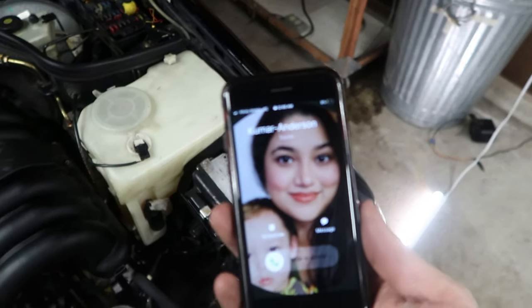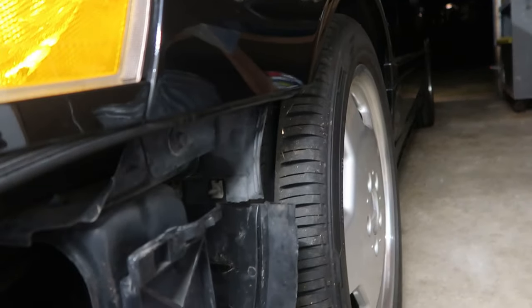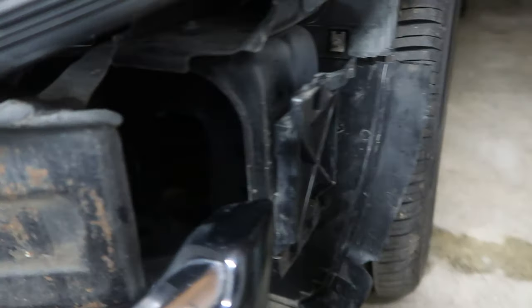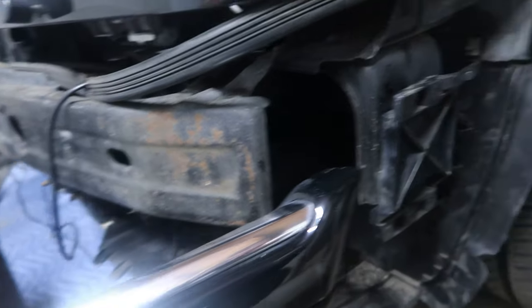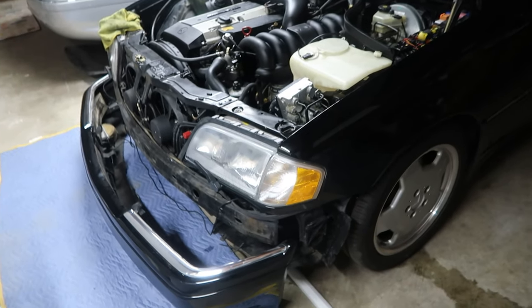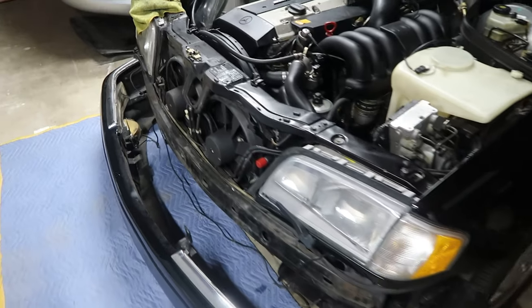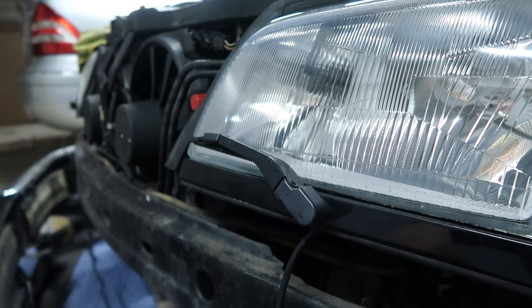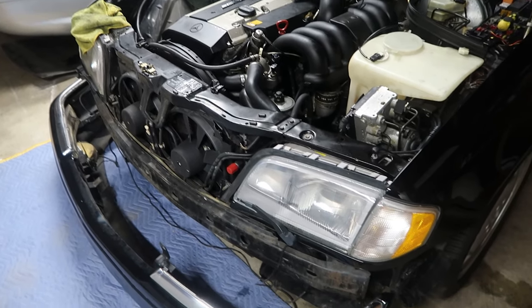Before I go inside, here's why the bumper was hanging loose: this bracket was just loose. There are two 10mm nuts holding it on — just tighten that up and match it with the other side and hopefully it lines up. It's funny — this is literally the first big project I did back on my first W202, and it's all coming back to me. Full circle for sure. Also, let me know in the comments: should I keep these trim pieces? They're not really my thing originality-wise. Oh — giant moth. Time for bed.